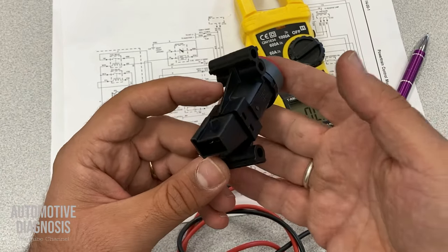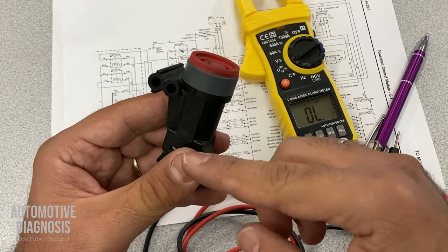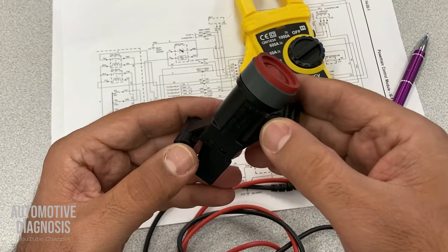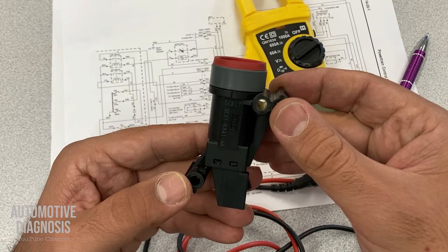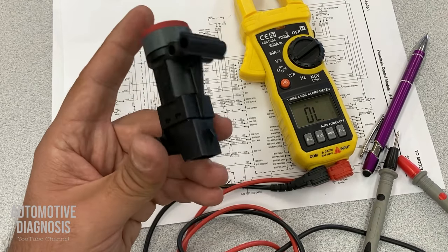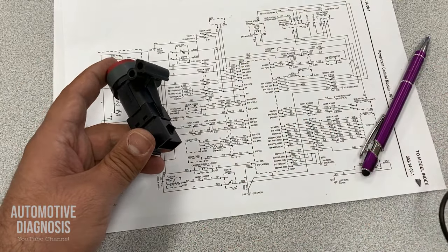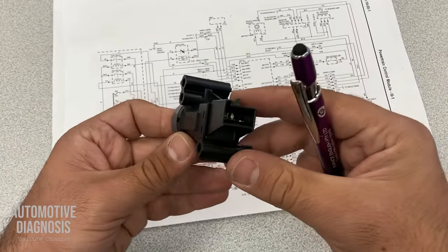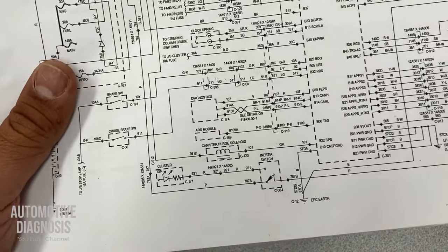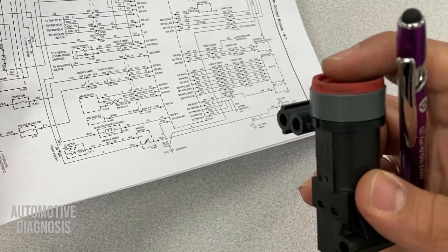But if something happens like my case, if I do have the continuity, the problem was just that switch, which jumped up because of the hard braking, so it made the open circuit for me, and I just needed to reset it. After resetting, everything is okay and I can put this one back on the car. So this is how you can check the fuel cutoff switch. But obviously, if any time in case of emergency, you have this one faulty or you don't have anything, if you try to reset it, you see it doesn't work.